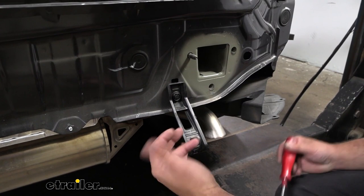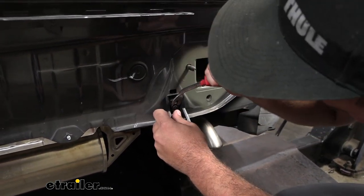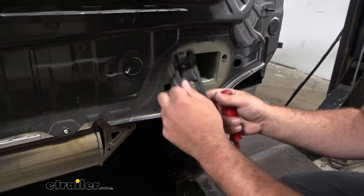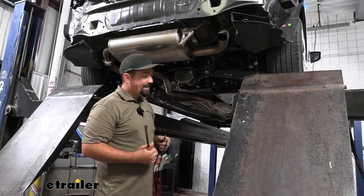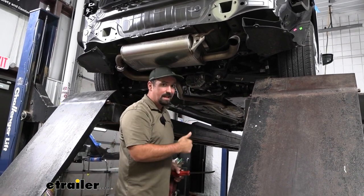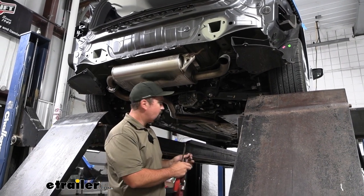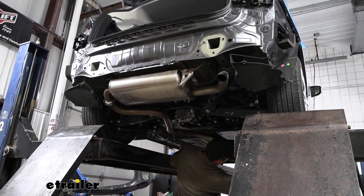We do need to remove these plastic bumper hanger brackets — there's a recessed plastic push pin, so just pry in the center there, and with that removed it's just got a little clip, so slide it up and set these aside. Now we need to lower down the muffler to give us access, but you're going to want to support the exhaust, because once we take it off the isolators it's going to want to hang down and that puts a lot of stress on the rest of the exhaust. If you're doing this in your driveway or garage, you can put a block of wood or a cardboard box to support it; since we're on a lift here, I'm going to be using a cam buckle strap to create a cradle.